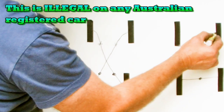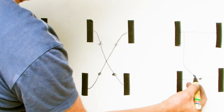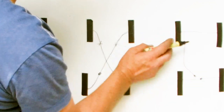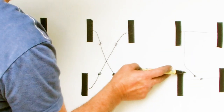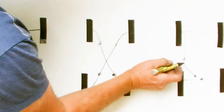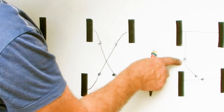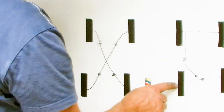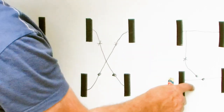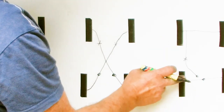So what I'm going to do is relink the front brakes together off one output of the master cylinder, and relink the back brakes to the second master cylinder. I'm still going to have a dual circuit braking system — if one system fails, front or back, the other one will still work. But doing it this way means I can put a brake bias adjuster, which is really just a block-off valve you adjust by hand, right next to the driver, so we can adjust the braking on the back and get more braking going to the front.